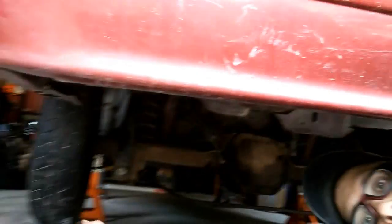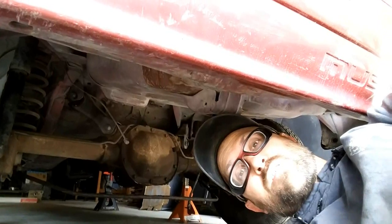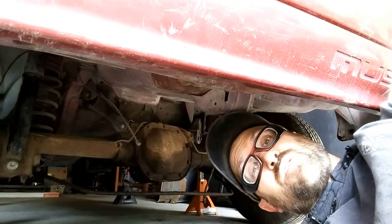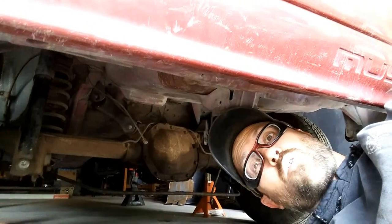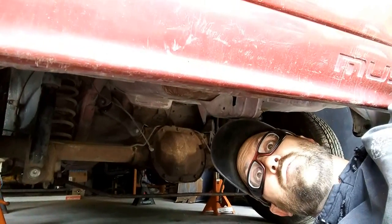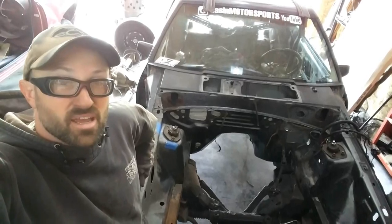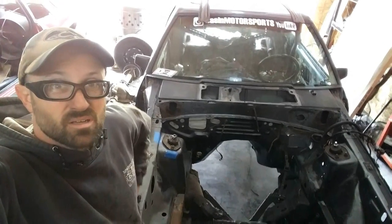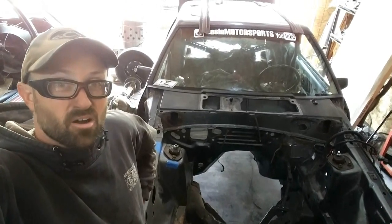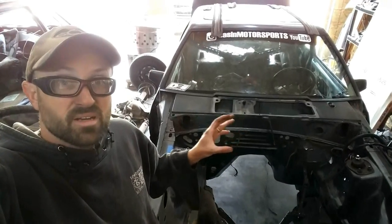For right now I'm going to save my money and just run with some pretty basic suspension pieces and I'll eventually come back and do that with some good quality stuff. Here's the '92 - obviously the strawberry color. Here's the '92 up underneath and if you notice right here, that's the spare tire from the '92 that I got it home with - it won't actually take a regular size tire, not even a 205, because the quarter is so crushed. So I put the spare donut back on so I can roll it up on the trailer. What's left on the '80 now - the k-member is still in there, so I need to take it off, which is about six to eight bolts. I also need to disconnect the steering arm from the steering column down to the rack and pinion because I'm going to reuse that piece, and the sway bar mounts.